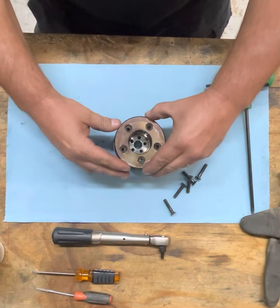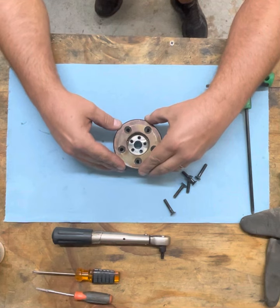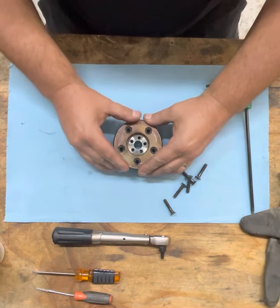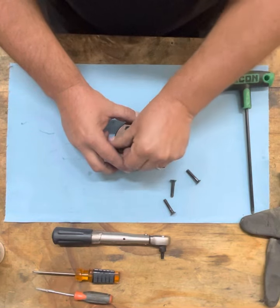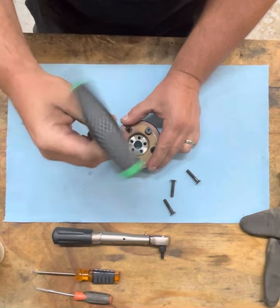So let's put this down nice and easy. And then while we're looking, I gotta adjust a little bit, and then boom. I saw it and I felt the washer go down. Now you gotta keep applying pressure down on the lid. We're gonna put 2 screws in here. While we're applying pressure, you don't wanna release it or else that washer is gonna pop out of the bore.